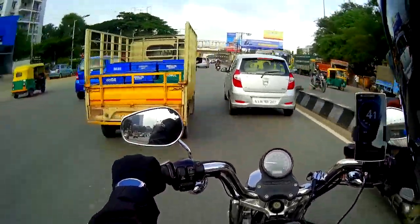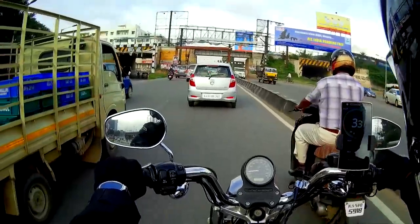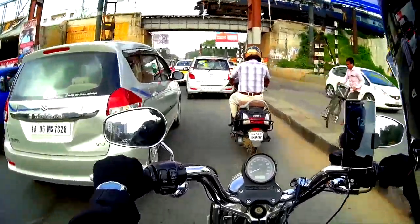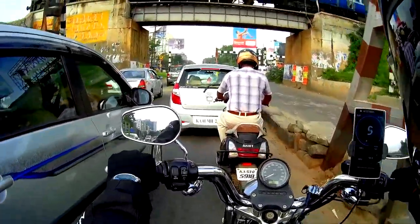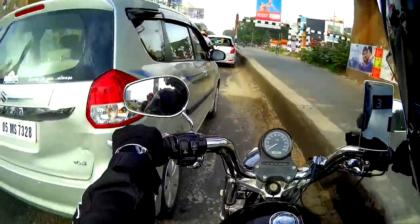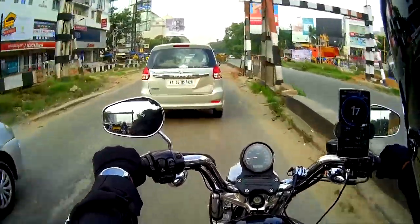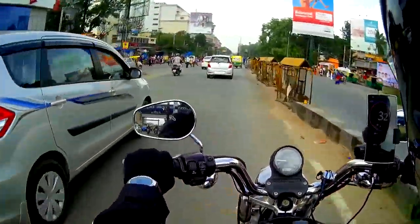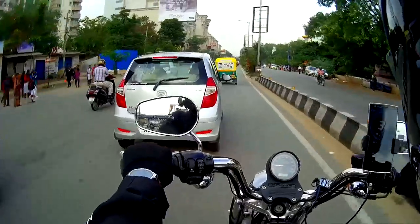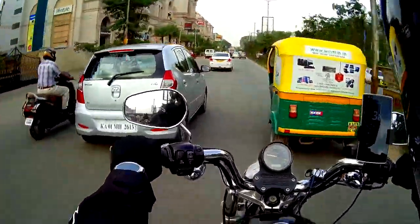So when it's off, when it's parked, it's off. So no battery drain. The step down circuit also doesn't heat up or get worn out unnecessarily. So the whole thing is completely off when the bike is off. So if you mount charging solutions to your bike, look out for something like that. If you can do that, I think it's much better. The thing will last longer because it's not always on, and you have peace of mind from knowing that your battery is not getting discharged. So that's that, and it's been working pretty well.